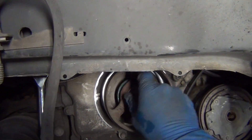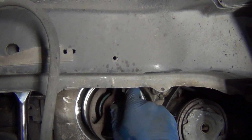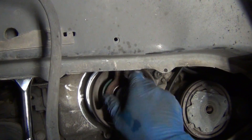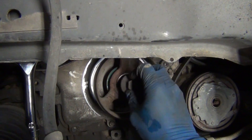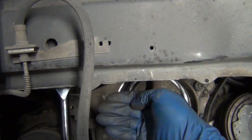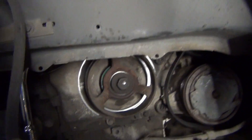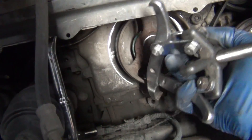We're going to pull this all the way out and then go back in just a hair. How do you do this without an extra M14 by 1.5? I don't know. Because you can't bang on this thing or else it'll mess up the thrust washer on the crankshaft - basically a skinny washer that keeps it from going in and out. If you hammer on it you'll bust that thrust washer or thrust bearing. So my advice is don't. We're pushing only on the crankshaft, not the engine.